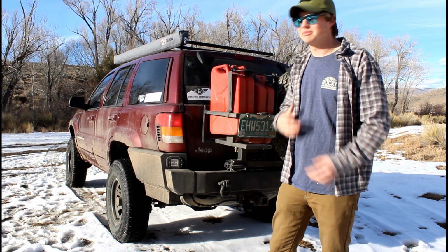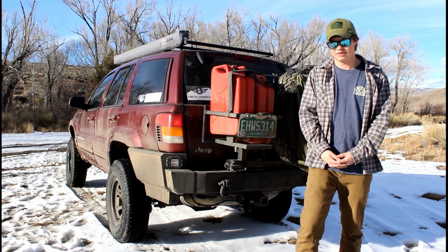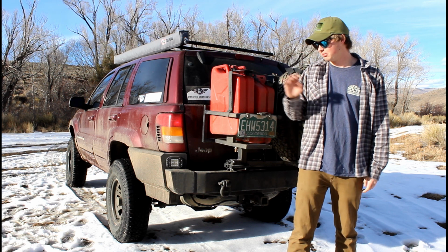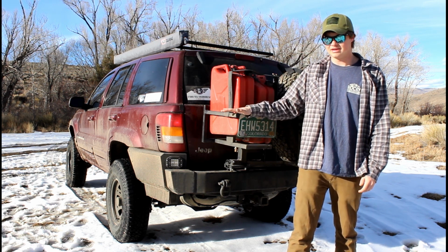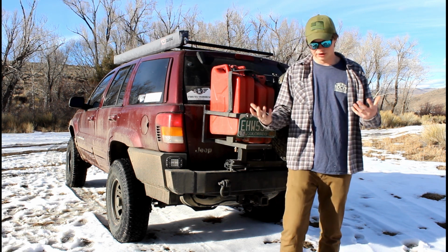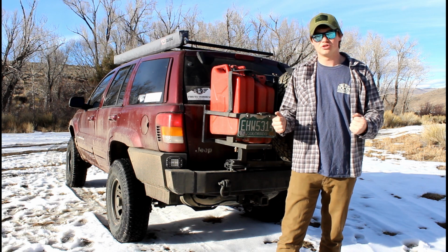As well as that, that bumper had an issue where at about 55 miles an hour on the highway, on a concrete road, the tire would shake back and forth. It's probably due to the wheelbase and the distance between the corrugations on the road, but it would shake back and forth to the point in which the entire Jeep would move.